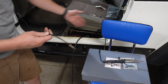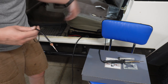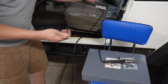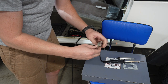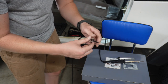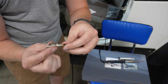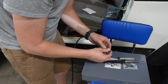I got the coax cable routed all the way to the front of the Jeep, following the factory wiring harness under the dash. It's coming out right here next to the OBD-2 port. While I've still got some slack, I'm going to go ahead and solder on the connector. Not all cables come this way, but this one did — it makes it a lot easier to fish the line through places. I'll slide the connector pieces together and solder that center pin in.